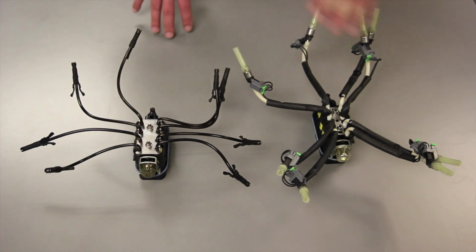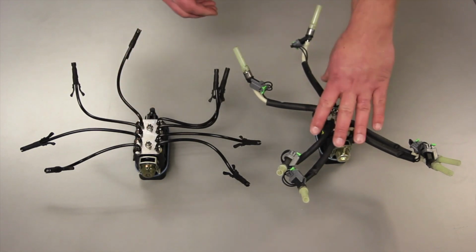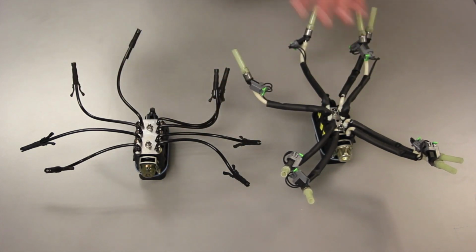So a popular update has been the conversion to multi-port fuel injection, from CPFI to MPFI, in which the injector is now at the end of the tube here, eliminating a lot of those issues. This has been a great, very successful conversion.